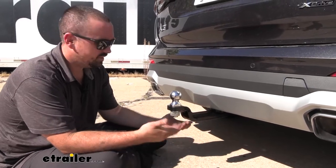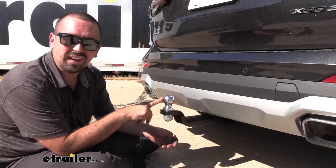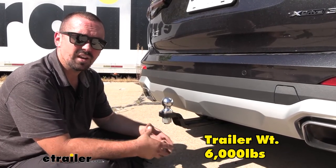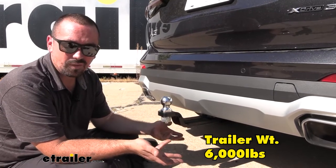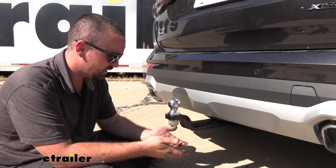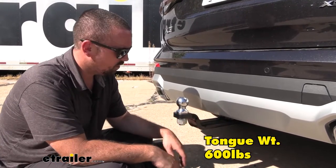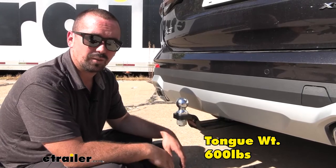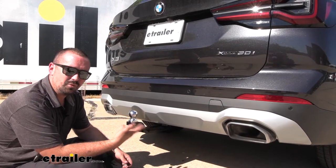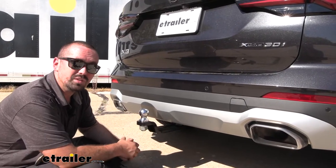This actually has pretty good towing capacity, especially for a hidden hitch. It comes with a 2-inch ball rated at 8,000 pounds, but the hitch itself is rated at a gross trailer weight rating of 6,000 pounds — that's your trailer plus accessories loaded on there. The tongue weight is also very good at 600 pounds. Before towing at the rated 6,000 pounds, check the vehicle's owner's manual, compare that with the hitch rating, and take the lower of those two numbers to stay safe.